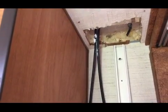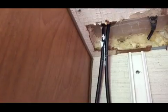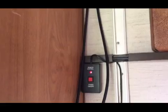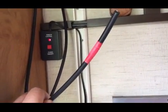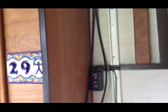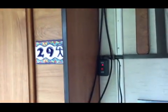Right, back inside now. You can see just there up in the corner, those two wires that are coming down out of the gland are now here. Positive cable with the red tape on, so I know what's what. Now what I'm going to do, on the side of this cabinet up there, is stick the solar controller. I've got some conduit there, so I can run all the cables right down to the batteries down there, which is to the left of the driver's seat.